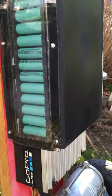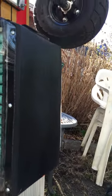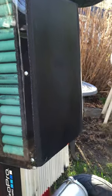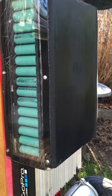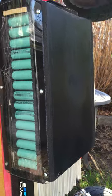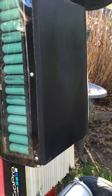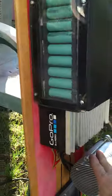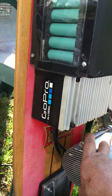If you did the specs, this board is 800 watts at 36 volts, which would be about 30 amps — but that's not how it works in the real world. An 800-watt motor like this will draw intermittently about 65 amps. I've specced it out and seen it do 1,800 to 2,000 watts at peaks. So before you build a battery pack, you have to think about what your current draw is going to be. The motor and speed controller on this are a 36-volt, 800-watt setup.